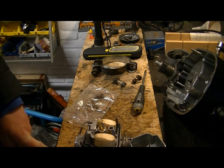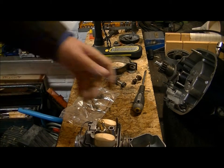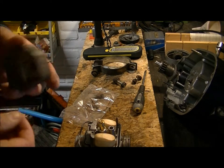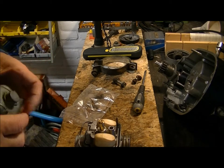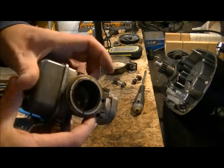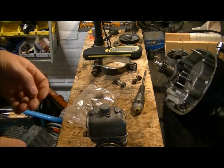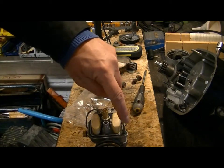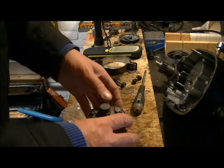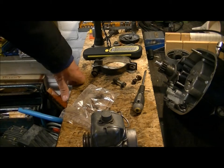So it's still to be continued. Anyone who thinks they've seen what I missed, please post comments and tell me about it. I can however rule out some other options — my choke is not leaking, absolutely sure, checked on that. This is the choke sucking pipe, but the choke is okay. I have not been driving around with a permanently open starter.